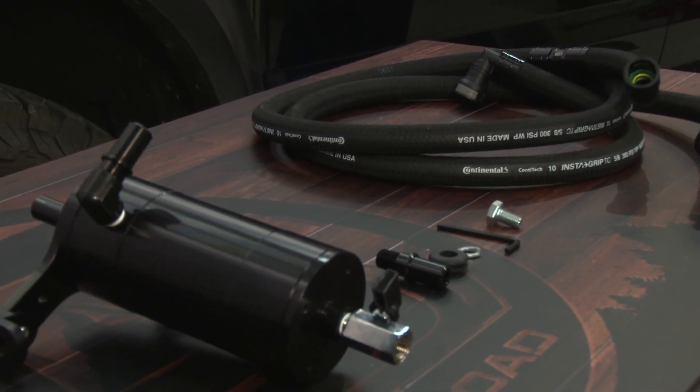This is very approximate and not super crucial, but we're going to put the inlet for this wide open throttle line right about here — one inch down from this line and one inch over from this canister area. Grab yourself a 51/64 drill bit or a universal bit and drill it out. Install the supplied grommet into the hole, then install the supplied fitting into the grommet.